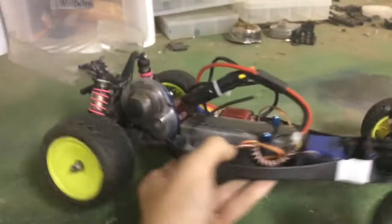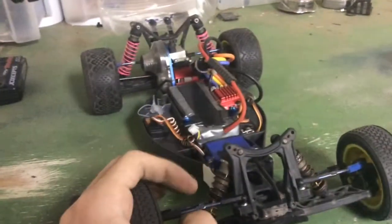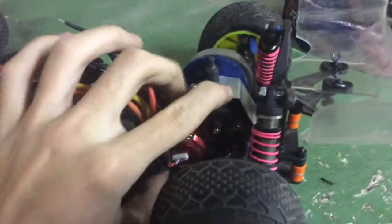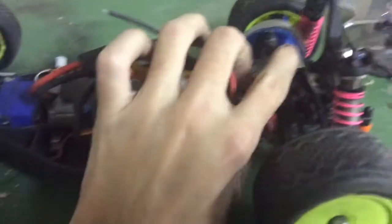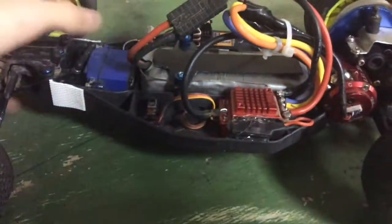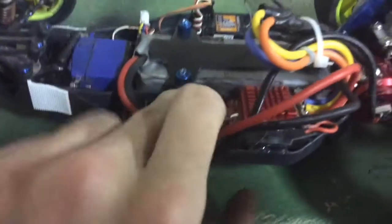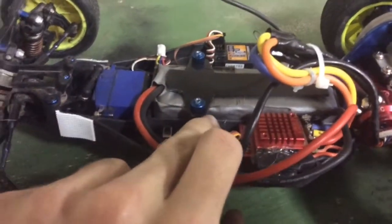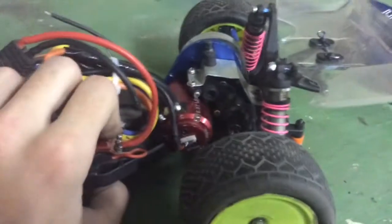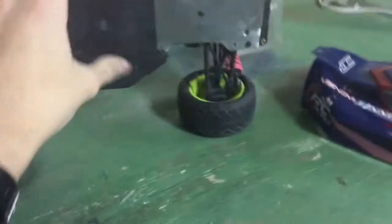Okay guys, we're back and this is the finished product — my B4 mid motor. I wouldn't call it a mid-motor B4.2 obviously since it uses a B4.1 chassis, but yeah. What I did for the rest of it was I made a brace right here for the motor so it would be protected if it took a hit, and it also doubles as my body mount plate. I glued down all my electronics and made my own battery strap out of a battery hatch for a Losi 27MHz radio.